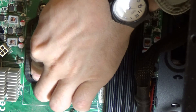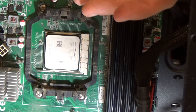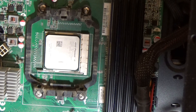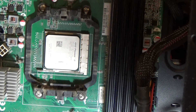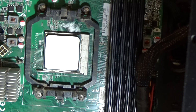Lock it down. Now the new cooler actually has thermal compound on it. I've used the Wraith on other CPUs and compared its compound with MX4 — I didn't really see any difference, so it's at least halfway decent. But before applying the cooler, I'm going to use 91% rubbing alcohol to clean the top of this CPU since it's used, to make sure there's no finger oil, old thermal compound, or dirt that might decrease the heat transfer efficiency from the IHS to the cooler. That's nice and clean.